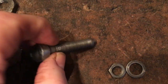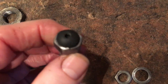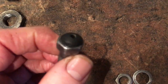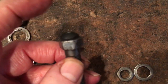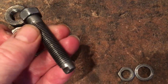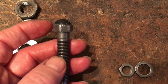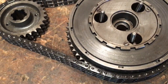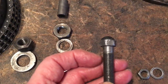Okay, I think that worked all right. Cut the rubber out, and I've pressed it in there with a bit of silicone sealer just to tack it down, but it will be under pressure most of the time from the slipper tensioner that sits on the top of it. So that's worked quite well. So this needs to go in first, and then we can place that slot in, slide the tensioner in, and we should be there. So we'll go and get set up near the bike.